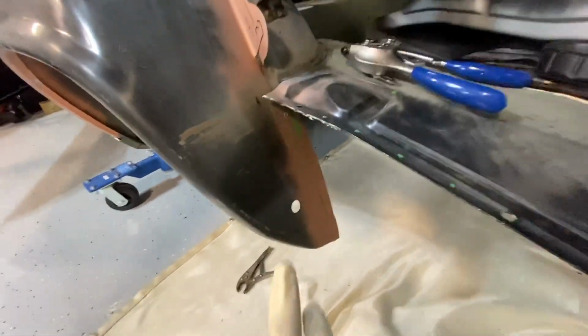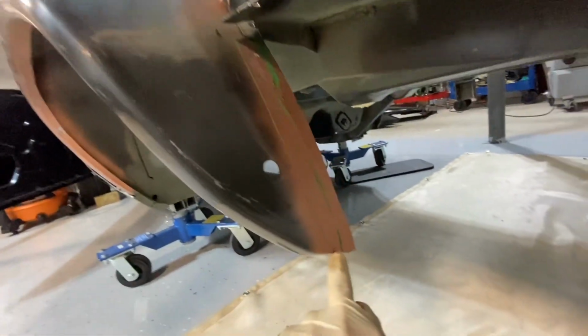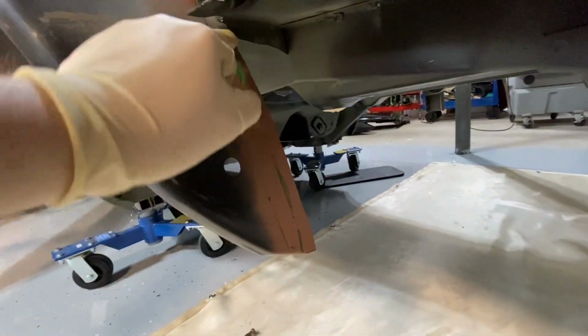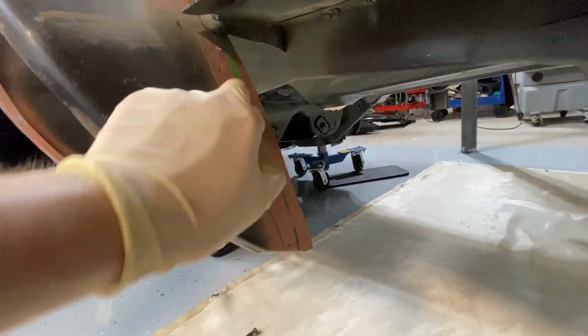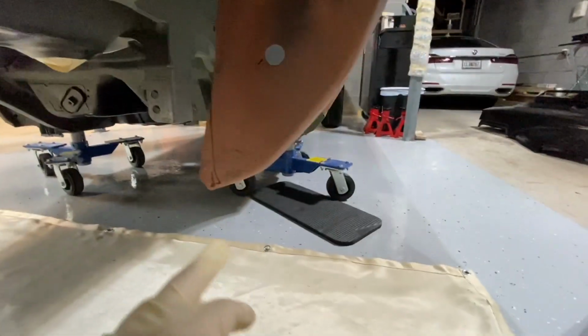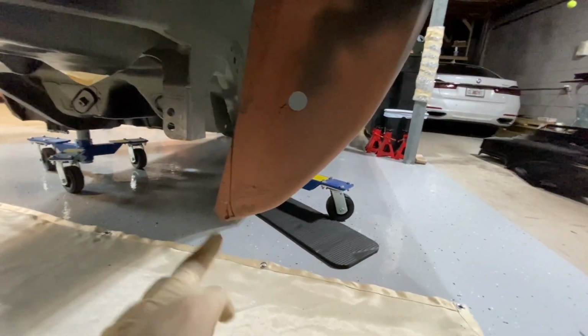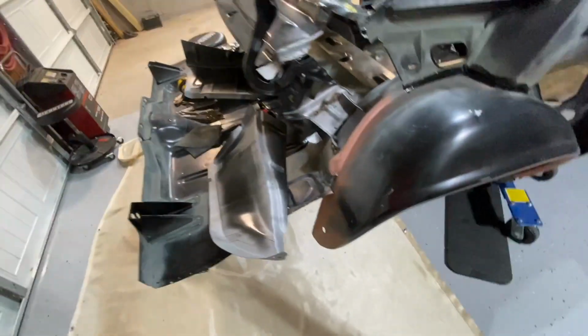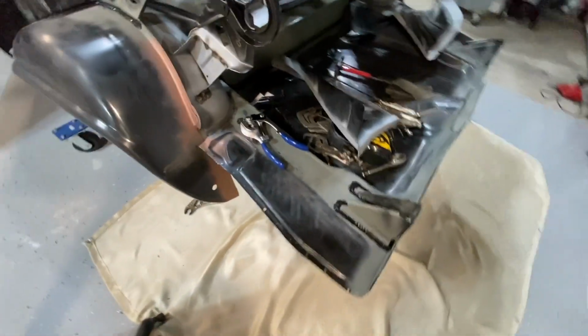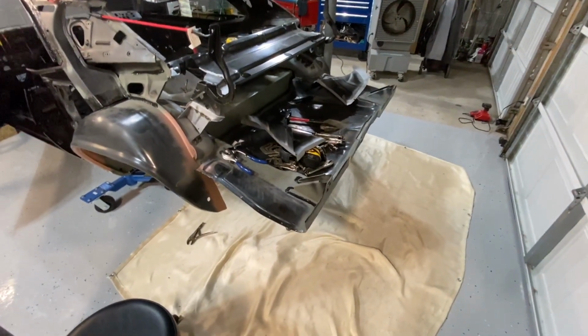As you can see, this wheel tub is off just a little bit. I think it's AMD stamping that I'm just going to have to cut pretty much that much off, but that's where it's going to go down on it. So I'm just going to drill some holes through that, weld that up. On the other side, it was a much better fit. You can see the only place that's overhanging is right here, but I did match my holes right here. Anyways, I'm going to get that going, punch these holes out, grind my edges, and I will get back to you guys when I have them test fit in the car.